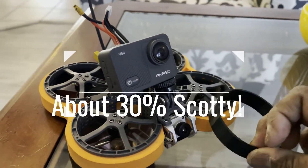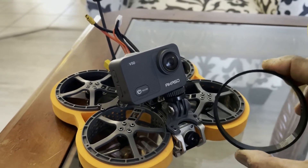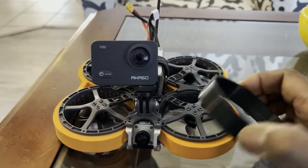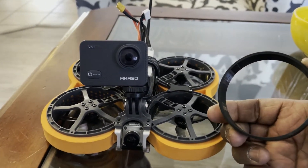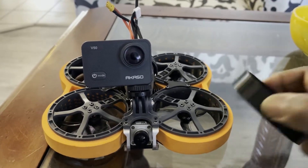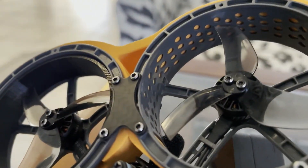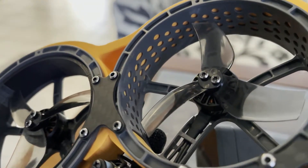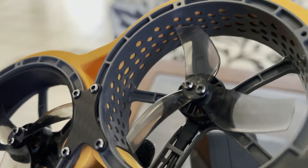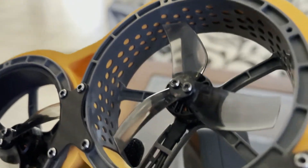Watch the video — the demo — and I'll do a full review on this. Diatone, I just fixed your problem with this loud quad. Hopefully in your version two, you'll make sure the props are closer to the ducts. I think that was the main problem, and not having these additional holes, which is not good for noise quality because it's just adding turbulence back into the airflow — and they're acting as multiple whistles inside your quad.